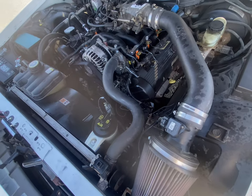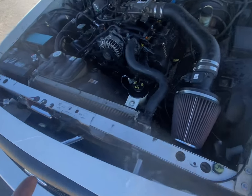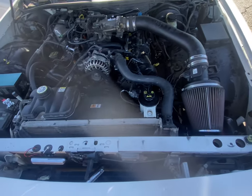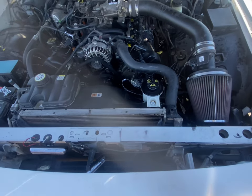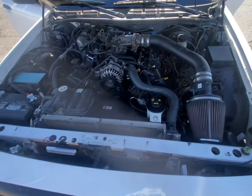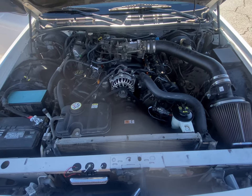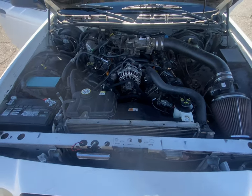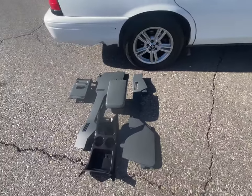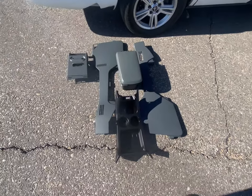I found the ignition coil connected to the spark plug that was the best out of all the ones back there, put that in and it changed it into a whole other car. It needs all matching coils and all new injectors - that's what I'm just gonna do. If I do that, do a compression test, and it's still misfiring then I'm just sending it as is. But it's running a whole lot better now - I can actually haul ass. I should have done that diagnostic on camera because it's stuff I learned from watching YouTube.